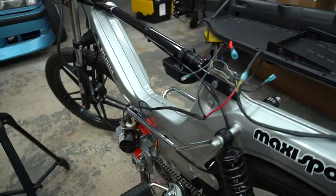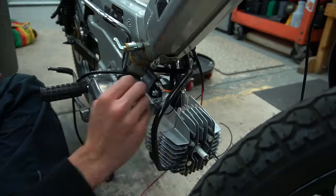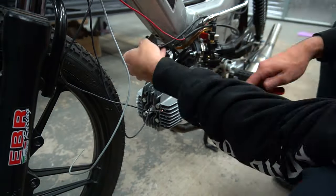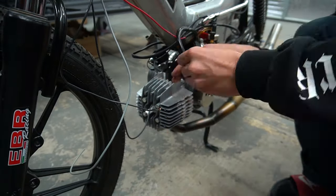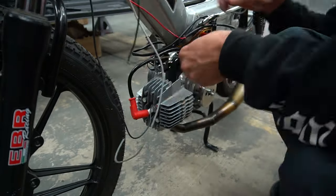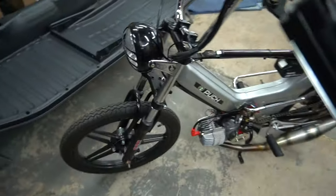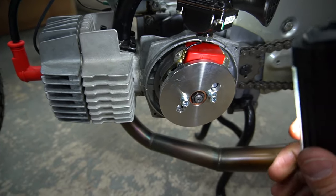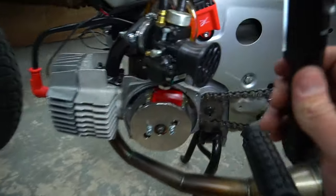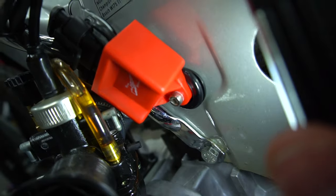This was the fun part — finishing up all the wiring, going in and cleaning everything up and tucking it all. I pulled the ignition coil off three or four times figuring out where to run my grounds. I went ahead and put a new spark plug boot on too — the type that uses the nipple on the spark plug, because I've had better luck with those since the other style nearly flattens out the threads. Damn near everything is now set on the pook except for the LED headlight. We have the flywheel weight on, and we're putting the cover on — I don't want to run it open in case a shoelace got in there. The CDI box is mounted to a rubber piece so it's not hard-mounted directly to the frame, to avoid vibrations.